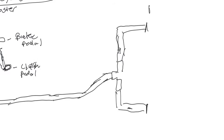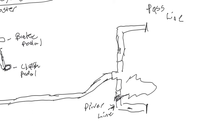So we're going to put the passenger line, and then the driver line right here. Okay, I had a problem here with a brake line that raised up, and when it gets to the chassis, there was a clip that was gouging into it, which caused, as we pressurized the system, everything to leak out everywhere. Big old leak, which explains why I didn't have pressure in my brake pedal, my clutch pedal, or anything, because this again is a closed system. If there's a leak somewhere, it's going to cause a problem.